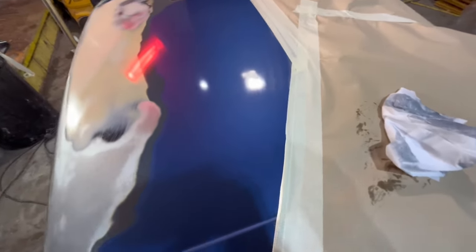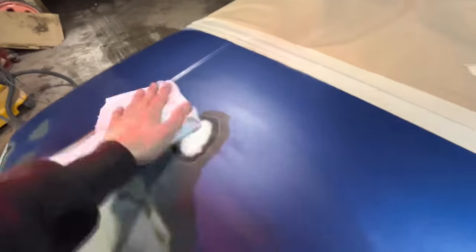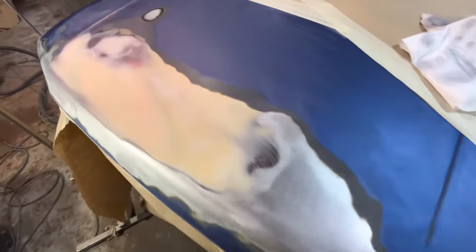That is the dolphin glaze rubbed down and that feels a lot better. Hopefully that's it covered. But now we'll give the panel a good panel wipe. So this just takes any grease, any dirt off of the panel and gives it a really good clean. So that should be it. See, look at all the dirt that that's taken off. But we'll dry it out now. That's us all cleaned off, ready for some primer.